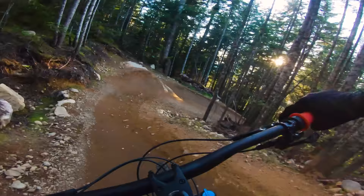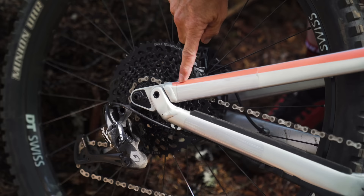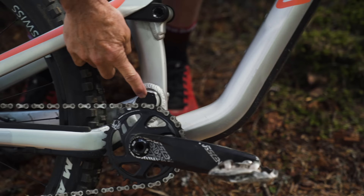The front and rear suspension is a little stiff, but honestly they're balanced, and as long as it's balanced your mind compensates and everything becomes intuitive — and that's really what makes a mountain bike great. One thing I like about this bike is it's simple. Check out this rear suspension — it's a Horst link design, just a simple four-bar. It's got 150 millimeters of travel, and there's very little to go wrong on this. The main swingarm pivot is completely sealed off.